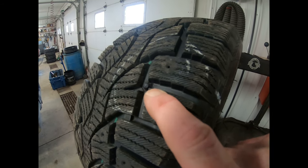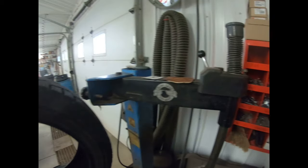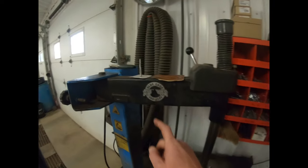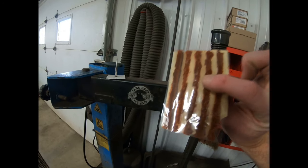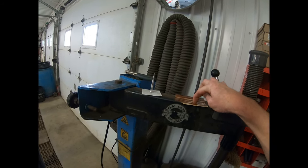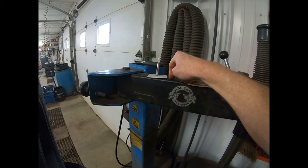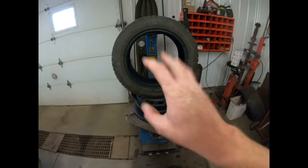In there you can see where the plug comes out, and it virtually now is just part of the tire. Once it's in there, we seal it with vulcanizing fluid, which will seal around the edges and bond it to the rubber in the tire, sealing in the air when you put this back on the rim. That's the benefit of using a patch plug like this versus a temporary plug — in a lot of provinces and states, temporary plugs are not legal for a permanent repair. Temporary plugs get you to where you're going. Getting a patch plug put in usually costs a few bucks, but because you have to tear the tire down off the rim, the repair usually runs between $15 and $20, plus you generally have to have the tire balanced again. It's a little more expensive, but it is a permanent repair. Let's get it back on the rim and back on the car.